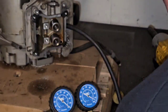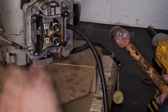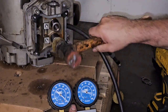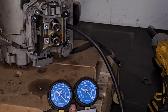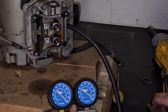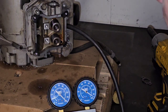What I'm going to do right now is tap these valves so all that pressure in the combustion chamber will let air blow past those valve seats, and any little contamination left over will be blown out. Now we're doing even better — we're at like 98%. That's really good results considering I have one head bolt missing and I reused the head gasket.